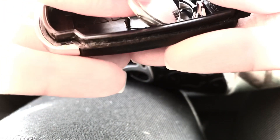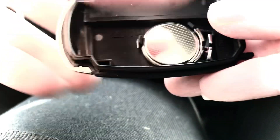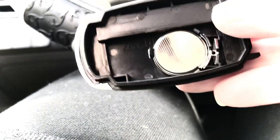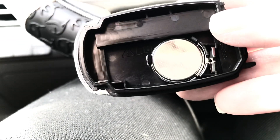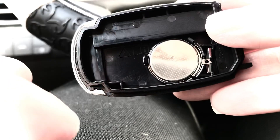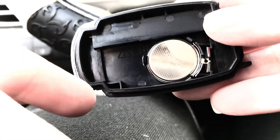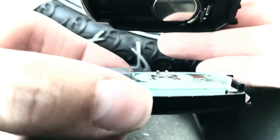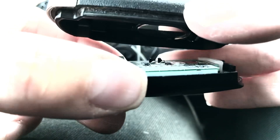If it doesn't want to go in, it's because there's a spring, so make sure your spring goes in like so and push on it. Now placing your key fob back together is the reverse of how you took it apart, with the exception of not having to mess around with that separation aspect. There is everything about your key fob — you're going to place it on top like so.